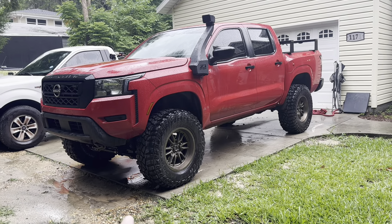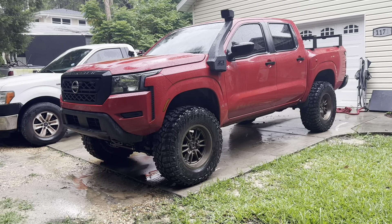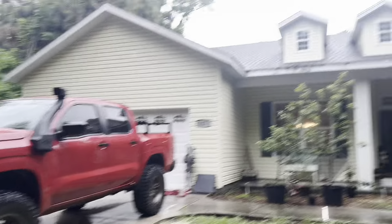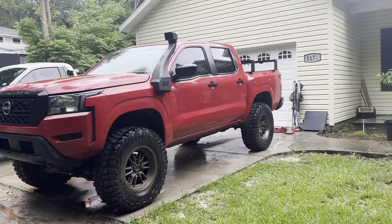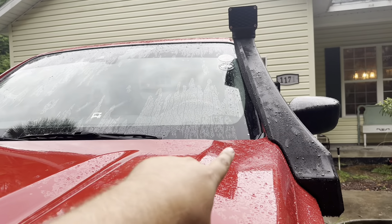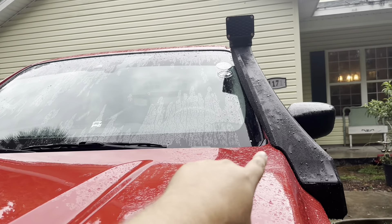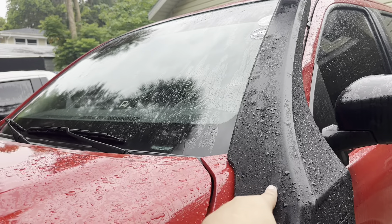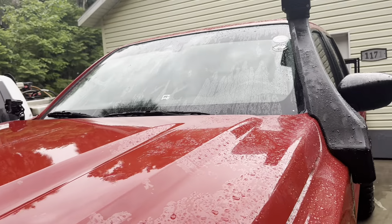Okay guys, we are back home and it's actually the day after we installed the snorkel. The rain came down really hard and I couldn't make any more video — all you heard was rain. So I decided to shoot the rest of this video today, and what do you know, it's raining again. A couple of things about the snorkel you need to know: first, it will not work with the CBI ditch light brackets. I had to take mine off because when you open the hood it catches on the side of the snorkel. If you have CBI, those aren't going to fit with this. Z1 sells their own ditch light brackets and I'm sure those fit. If other brackets stick out the same as CBI, be careful because you might not be able to use them.